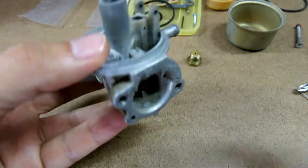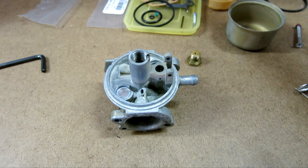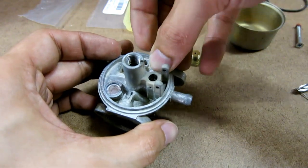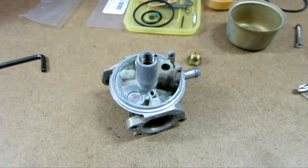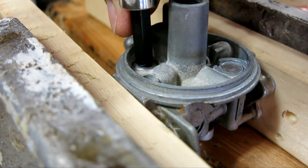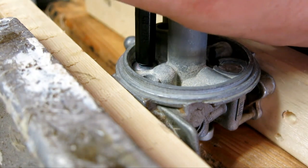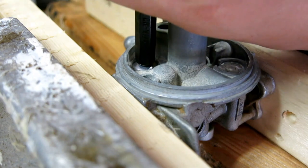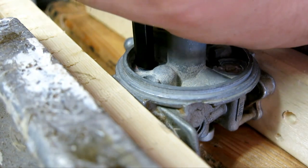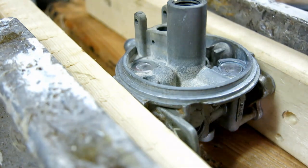That's pretty much it. Now since this is all cleared and cleaned out, I'm going to put back a new Welch plug. Here's my replacement one. All you do is put it on top — once the Welch plug is laid flat, you take a punch. I don't have a punch so I have a flat surface that will do. You just use a hammer and tap it in. You don't have to go too crazy — one more time — there we go, that's all you have to do.